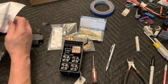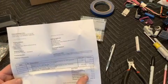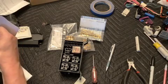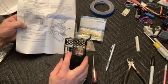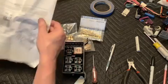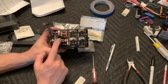Not the micro, but I believe the mini form factor. And so this one's not going to really be good for our current standalone system, but it would work, especially if you were running a manual transmission or didn't have the fans or something else where you just needed 6 fuses where you could just drop down on your circuitry essentially. And I was kind of showing you the prices there. Both of these are fairly inexpensive. I think one of them was $19 and one of them was like $12. So one downside to both of these is they are not watertight. And I was just showing you there that 6th relay location is not the standard size relay. It's a different size, and it doesn't really matter. We're not going to be using this one, but any of these would work well if you're willing to adapt a little bit.